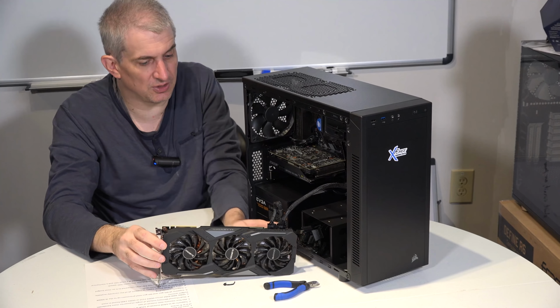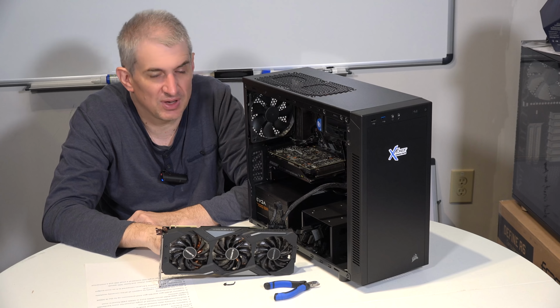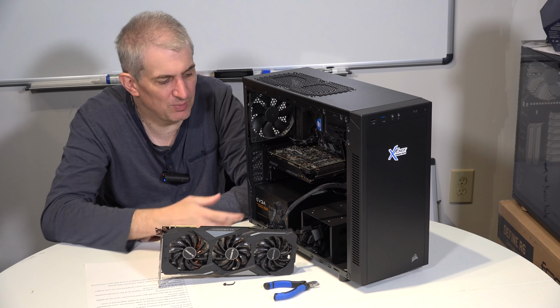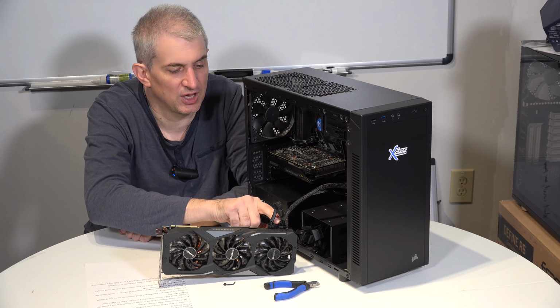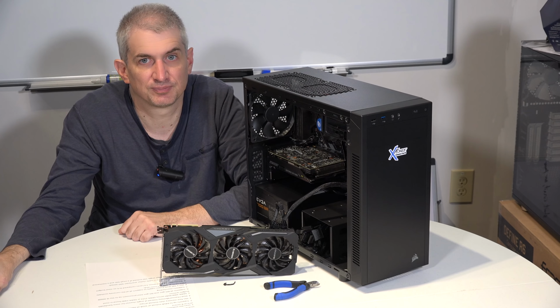Finally, it's not the easiest thing to do, to hook up a 2080 Ti, but you have a 700-watt power supply and you have two 8-pin power connectors. And actually down here, kind of cable managed up, there's another PCI Express connector. It will vary depending on which 700-watt power supply we have, but at the very least, you'll have enough to drive something like a 2080 Ti graphics card.